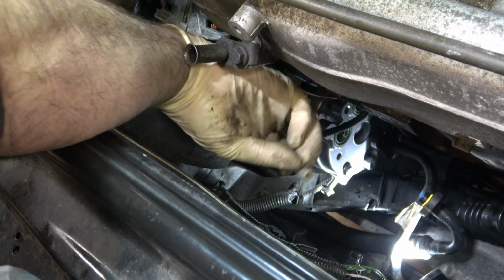All right, and then it's time to plug everything back in. Got that small purple line right there. Okay, and that hooks. Oh, the tab is broken for this one, so we'll just set it in there. Then the larger line here comes across the top. It lives there. And our big fan plug is right here. That gets reattached right like that. Then on this side, we have our purge valve, but the hose came off the bottom, so make sure to reattach that. And that goes back in. Slides into place. And now we just have our two 10mm bolts to put back in.